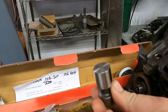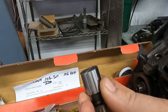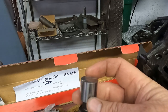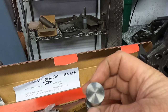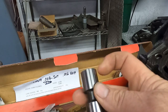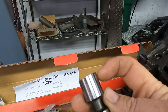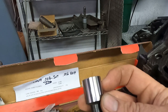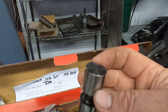If you get a lifter from an unknown source, you may want to buy a couple extras. If you take them to a good machine shop or a place that does heat treating, they'll have a Rockwell tester. You can have one tested. Sometimes if it's a really unknown lifter, it's good to grind a fair amount away — 80 to 90 thousandths — and have them check it down in the lifter a little bit.